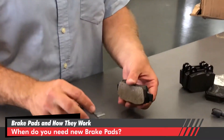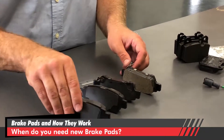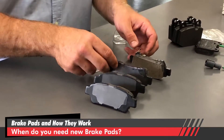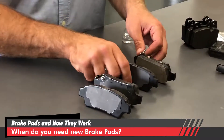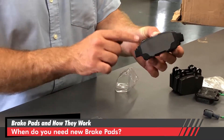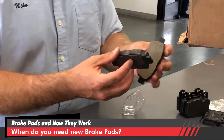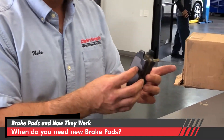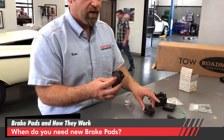This Honda minivan has four brake pads, but only two of them have a squealer. So when you rotate them, one side will have a squealer and the other won't. That's important — because sometimes the pad without the squealer wears down first, and instead of a warning squeal, you go straight to a metal grinding noise.